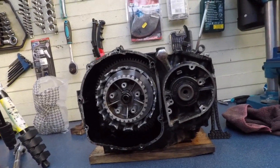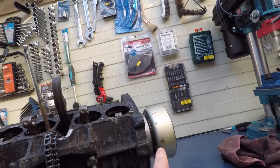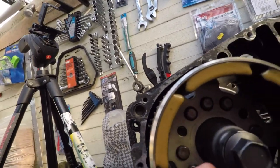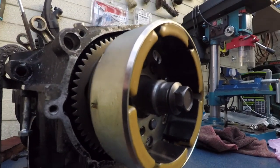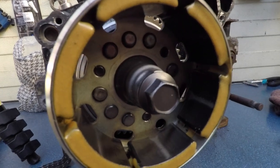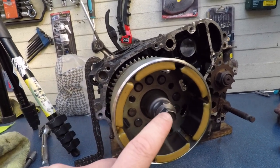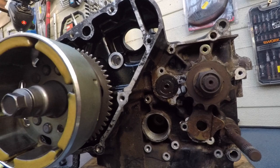And then on the other side, I need to remove this also because that has a clutch assembly for the starter. And I do have a 22 space here for a wrench. I'll try and remove this one today. Let's see. Yeah, I'll have to make a 22 mil wrench bend, but bend it so it fits in this to hold the rotor while I take this out. Otherwise, I don't think I can dismantle this engine.